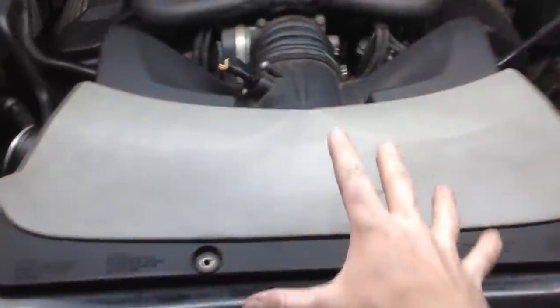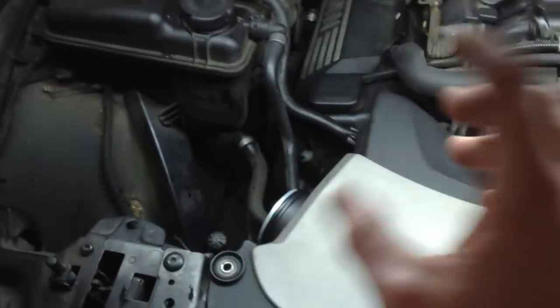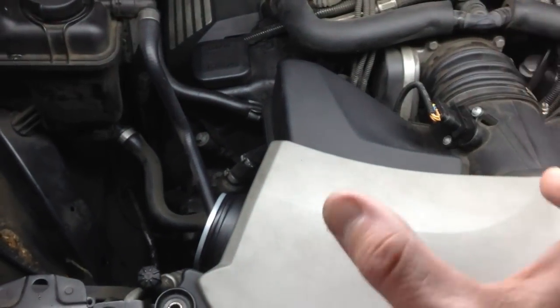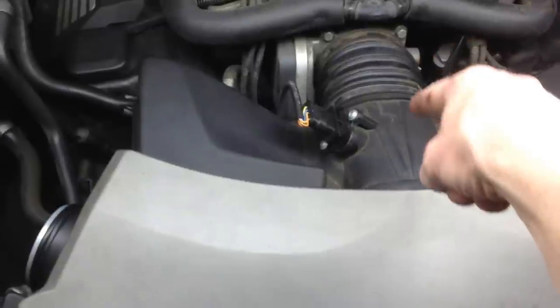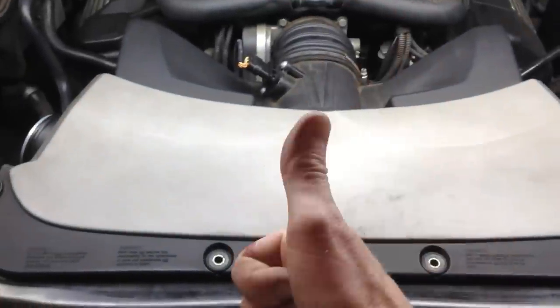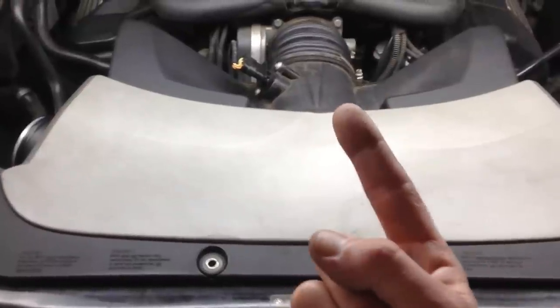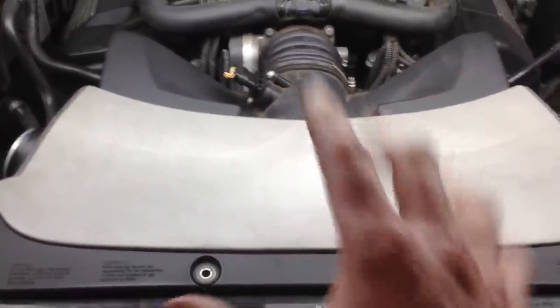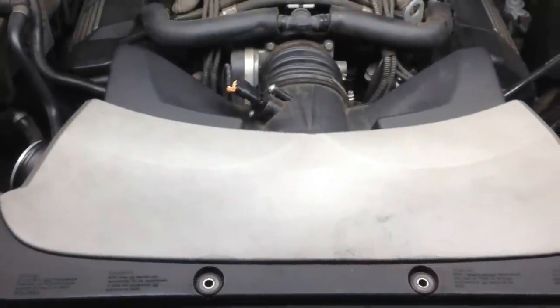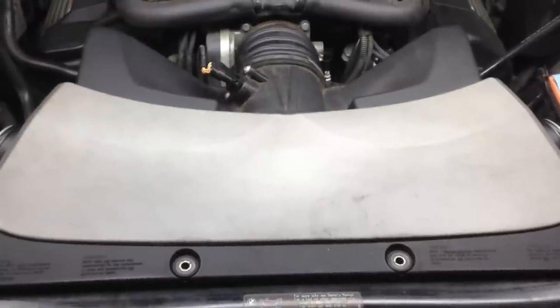Okay, so my loud fan has stopped. And now I need to put the car all back together. But it turned out, again, it's a dual option. I'm not sure if it was the water pump sensor, you saw how blue and weird looking that was, or if it was my bad sensor on my lower radiator hose. But the problem has stopped, which means it's not the bad fan. And because there was no wobble and no squirts from the gasket on the water pump, it was not the water pump. I'm eventually going to do that, but it was not it. The problem is fixed. Thank you, Jesus. Now I can get back to work. As you know, I depend upon my car for my livelihood.